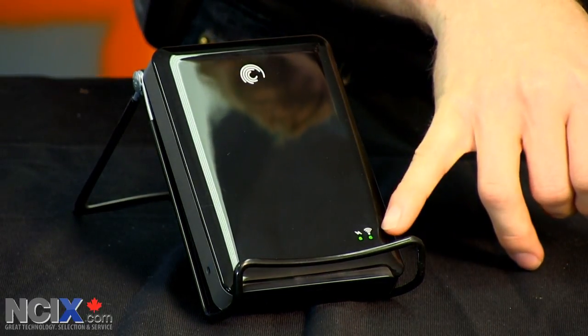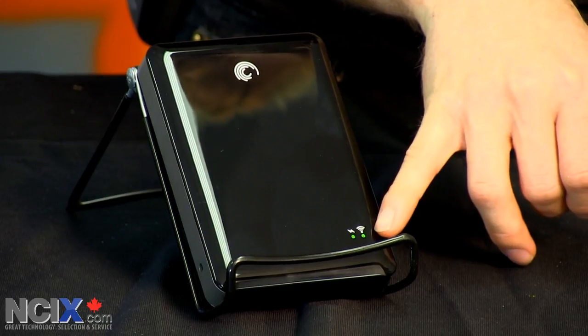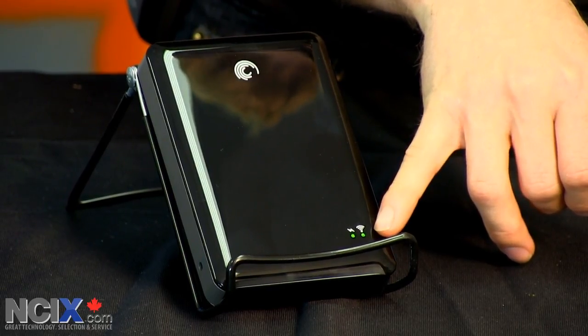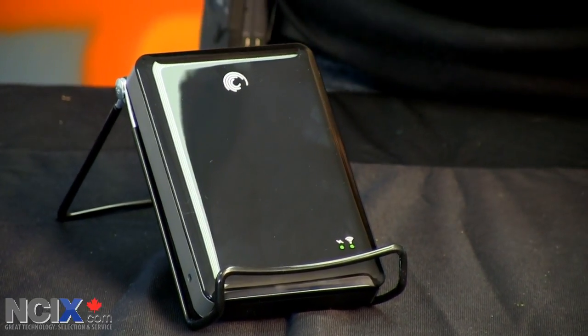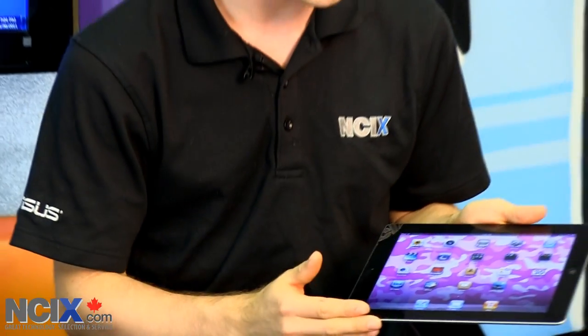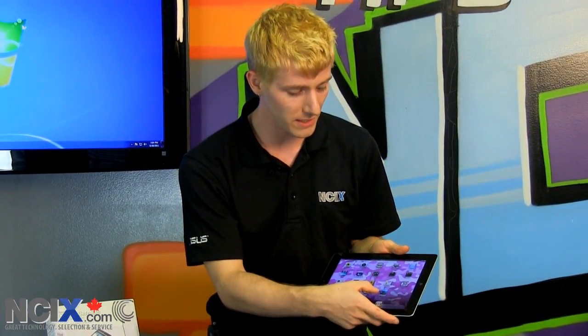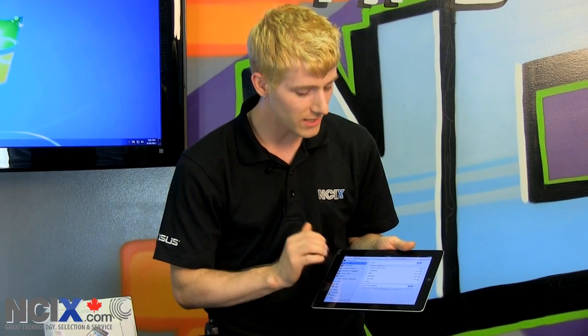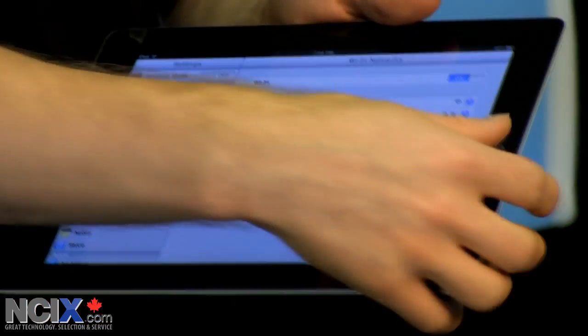I want you to take a close look at this little wireless indicator here. You can see it is glowing solid green right now, but it should flash blue in just a moment — there we go — indicating that the wireless SSID is broadcasting. So you can take your tablet PC, in this case I'm using the iPad 2, because there is a specific iOS app called GoFlex Media. But before you use that, you've got to go into your settings and connect your Wi-Fi network to GoFlex Satellite HPV.